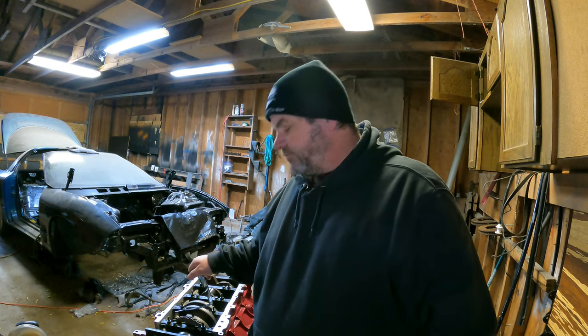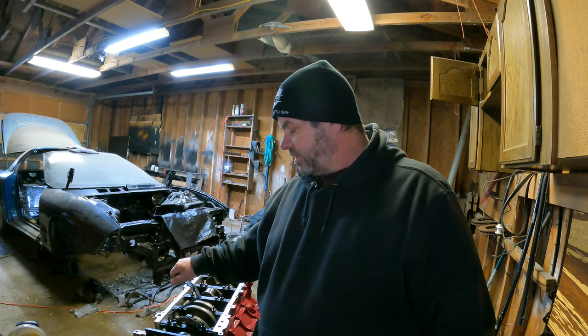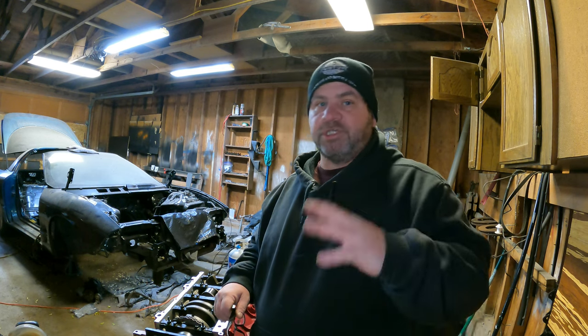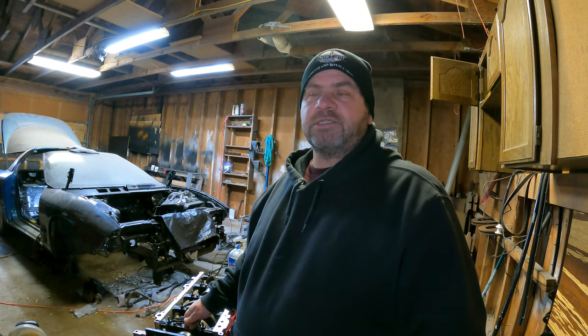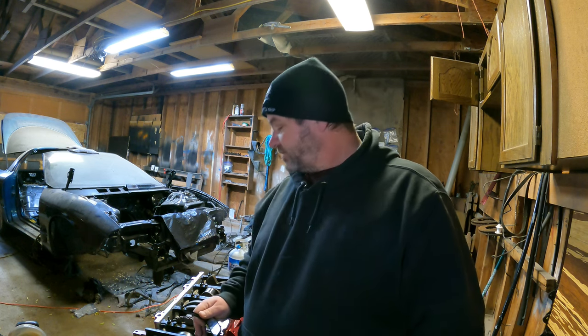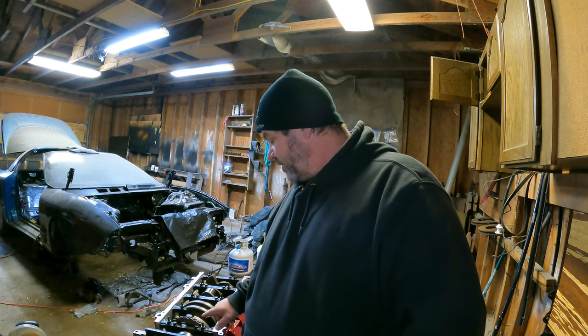We did 60 foot-pounds of torque on the inners, and we did 55 foot-pounds of torque on the outers, and that's pretty close to what I was seeing on YouTube for reusing those. A couple guys said do the inners at 65, but I got afraid, because it seemed like a lot. So I think 60 will do just fine on those.